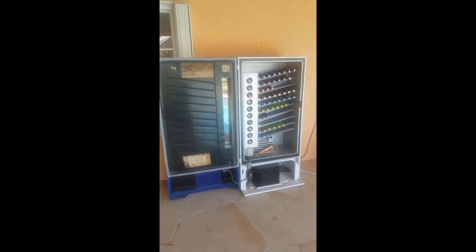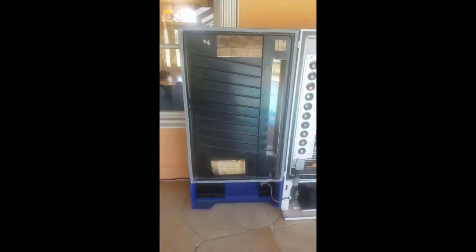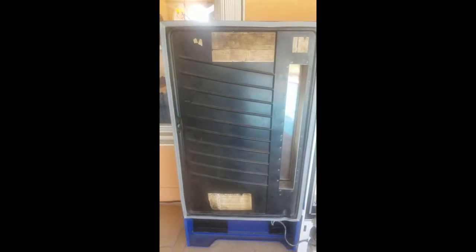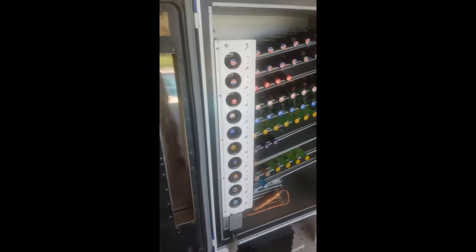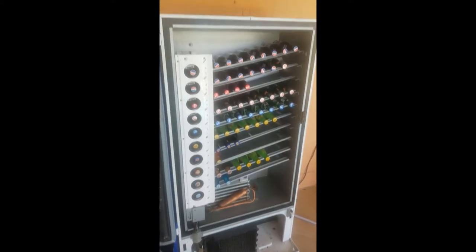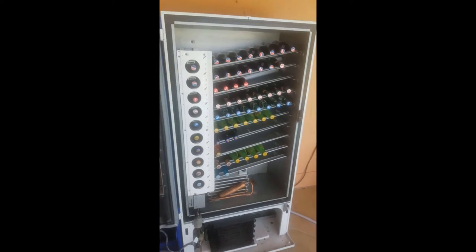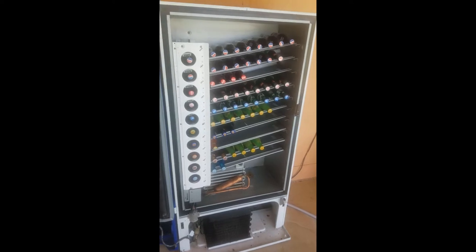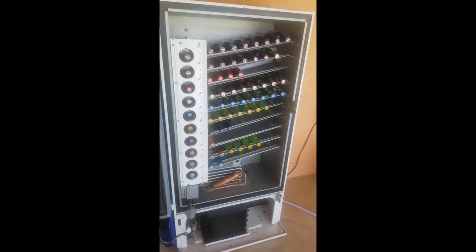So that's what it looks like restored — painted inside and out. I didn't replace the plastic liner; that was fine and reused. The labels, instructions, wiring diagrams, and other things on here are all original. I just put in new insulation behind there. I did have this completely apart and ended up going with mostly rigid foam — kind of a styrofoam insulation. I found that a lot easier to get in there and to get the tub in there.